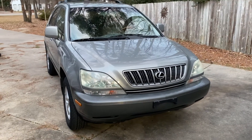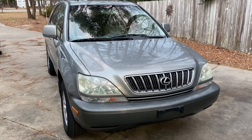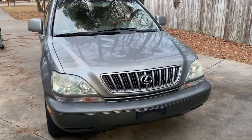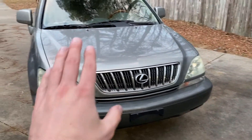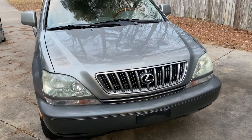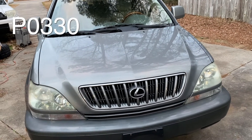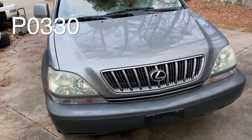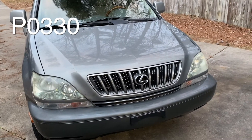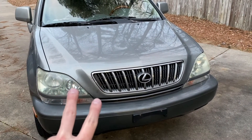What's going on guys. In this video I am over at a friend's house — we've got a 2003 Lexus RX300. There's an issue: this thing is going into limp mode and is not getting into overdrive. Did a little bit of research, there's a check engine light that comes on, and that is what we're dealing with — that P-something code that's coming up. Basically you've got two knock sensors, one of them constantly goes bad and the other one is always fine.